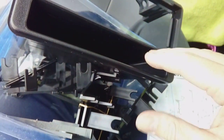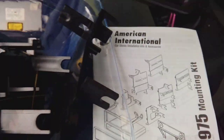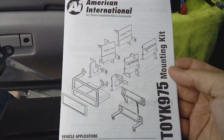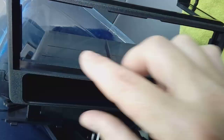If you're fitting a single din unit rather than a double din, you can use these fascia adapters to make the hole the right size. They normally come with loads of bits and bobs because they fit a range of different cars. The part number is by Auto Leeds — this is an FP1103. You do have to chop some tabs off these and put the right brackets on the side to get them to fit, but there are full instructions with them of how to do that and what cars to fit. A bit of improvisation is needed. Obviously if you're fitting a double din unit, then you can just use the metal plates off the side of the original radio, or you can get a pocket and block the bottom gap using the metal plates — whichever you prefer really.